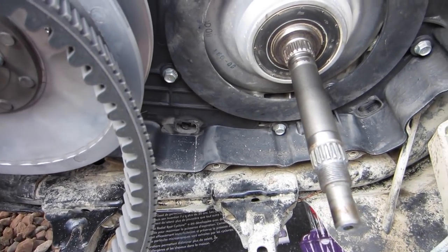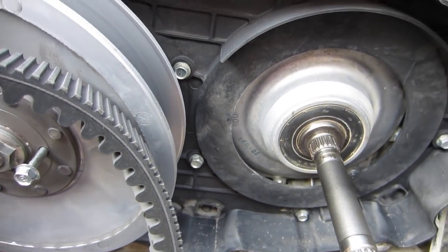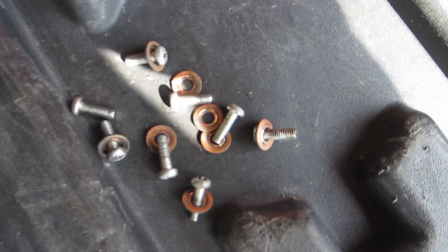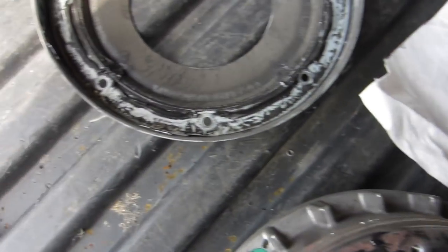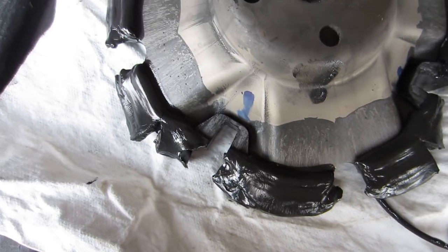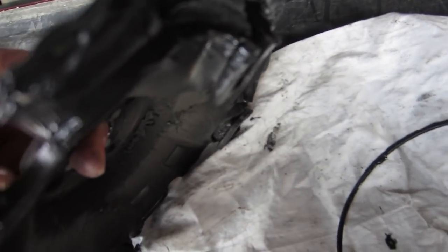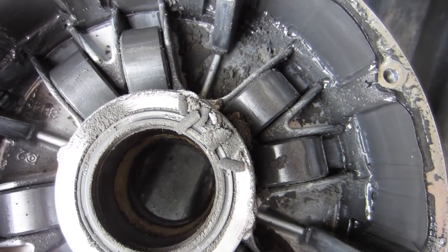Wow, it's pretty clean in there. Just blow it out with the air hose and she should be good — no water or mud or anything in there. I got the cover off — just little screws there. Use an impact screwdriver that you tap so you won't strip them. There's the O-ring — be careful not to wreck that. And there's the top plate with all the grease — you've got your little sliders in here somewhere in the grease, but they're in there.